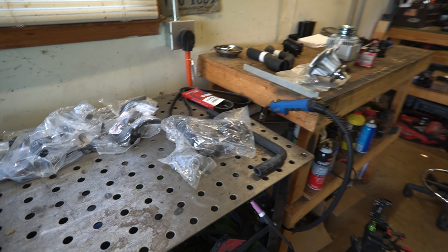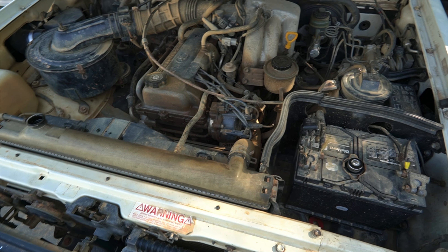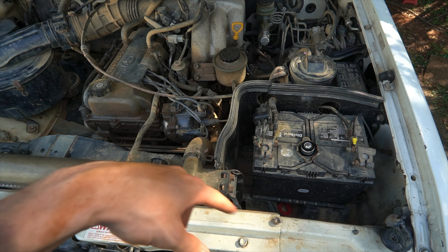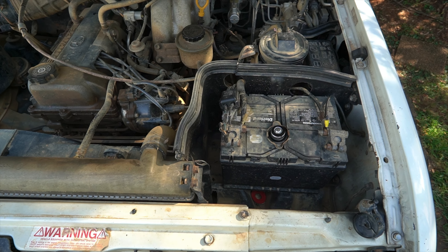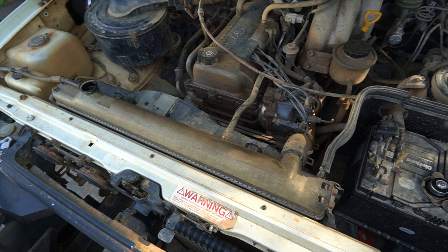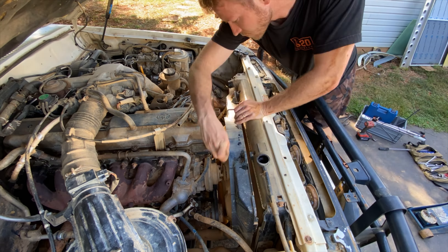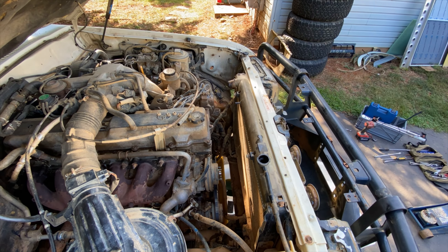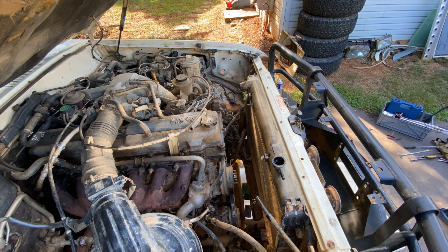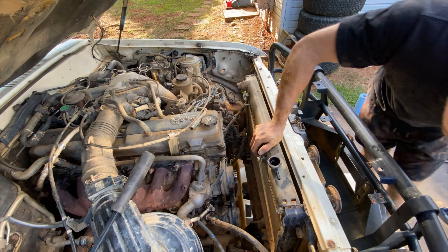Looking at the bay here, I've got the coolant already draining down. We're going to start by pulling the battery and battery tray — I'll have to rig up a battery stay since the existing one is non-existent — and then pull the radiator. To remove the radiator you'll also need to pull the fan clutch, fan clutch shroud, headlights, grille, and disconnect both the upper and lower radiator hoses as well as the transmission cooler hoses.